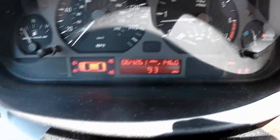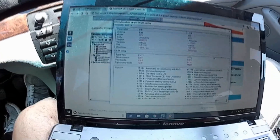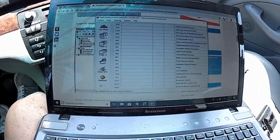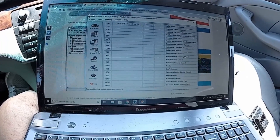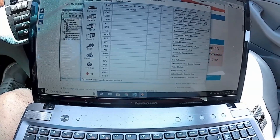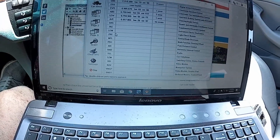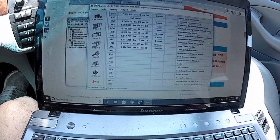When you do this you get a tamper dot, which means the mileage kept in the LCM and the ECU are not accurate — then you get a bunch of warning lights. We're going to fix that. As you can tell it's saying a lot of this doesn't match. I guess this came from a diesel — a manual apparently. Now we're going to make it all match. Hit scan. We're looking for the LKM. LCM — it says 18 errors, so obviously that's not right.